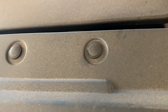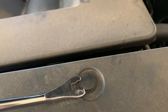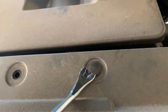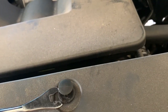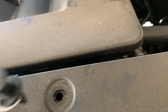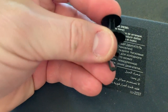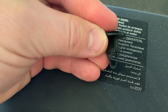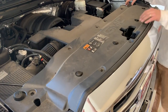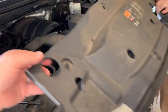Go ahead and get all these removed and then you'll be able to lift this piece off the truck. You take this tool, slide it under, lift up the top, then come back into the bottom and the whole thing just slides right out. This is what the piece looks like — it's locked whenever the top pushes down into it and pushes out the side. With all the hog nose clips out, it just lifts off and you set it to the side.